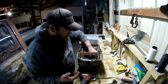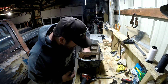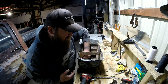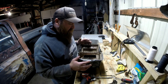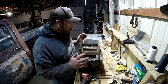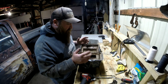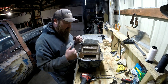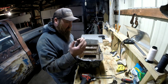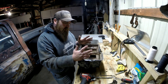I'm going to spare you the time of watching me put it back together — if you've made it this far you can probably figure it out. Set your heater core back in there, make sure your lines are lined back up when you go back through the firewall. Hook all your cables back up — there's no adjustment on those, so it's pretty straightforward. Hook your coolant lines back up, fill your radiator back up, double check everything, and you should be good to go.